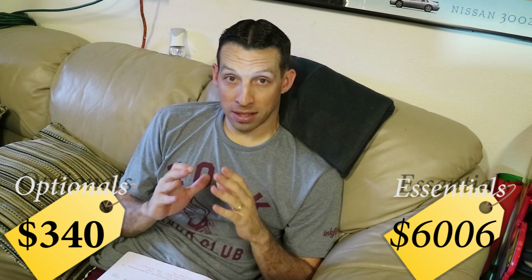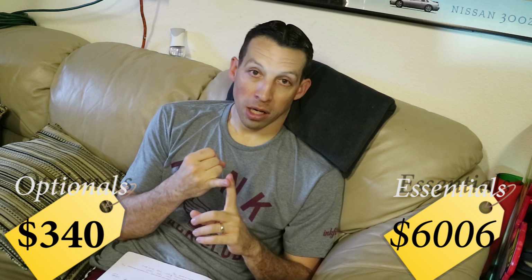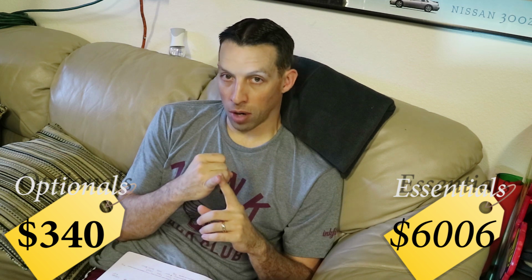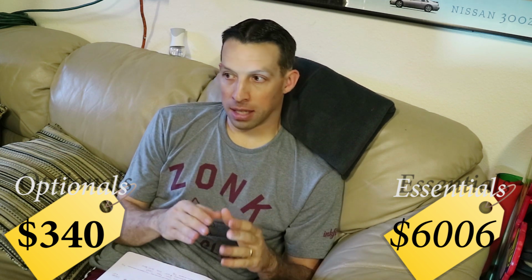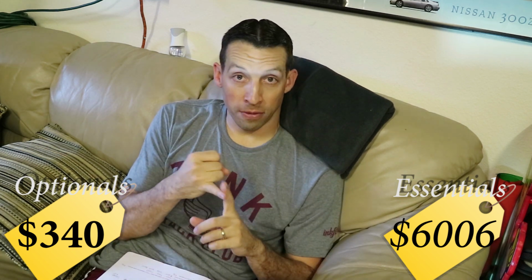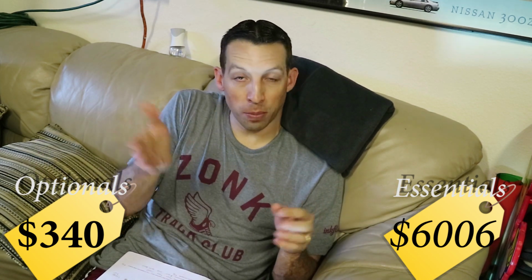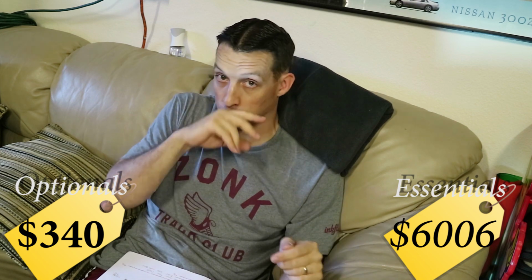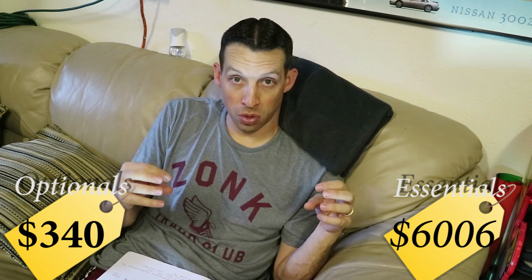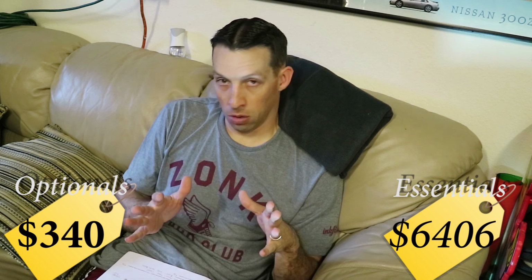If we want to talk about necessary things to the engine, there's one thing you're going to have to do. You've got two choices. Mock up an RB25 oil pan to your RB26, which I really don't recommend. It's just as easy to take the stock RB26 oil pan and modify it. All you have to do is cut off the differential housing. You pull out the axle from the center of it. You have to shave some heat dissipation fins off. Get a shop to weld those axle holes shut, and you're gold. You're done. They not only made custom plugs for the two sides, but welded the aluminum and everything like that. $400 for the welding. In your local area, it might be cheaper.